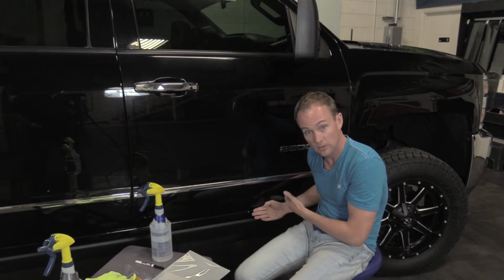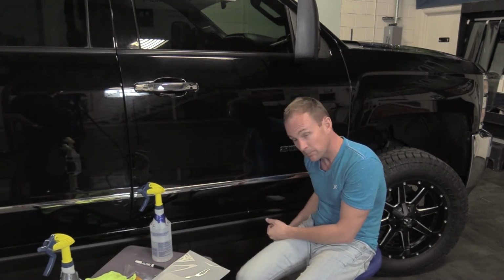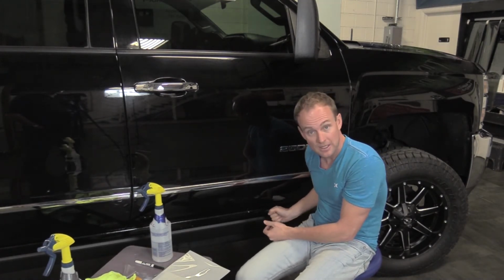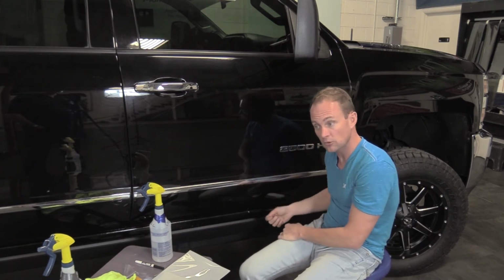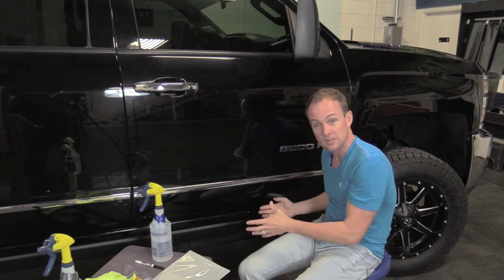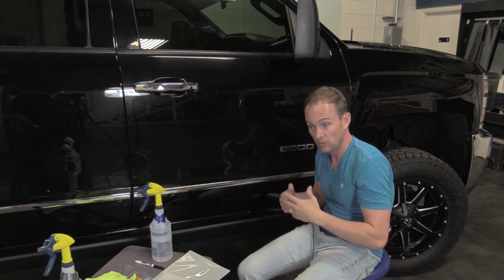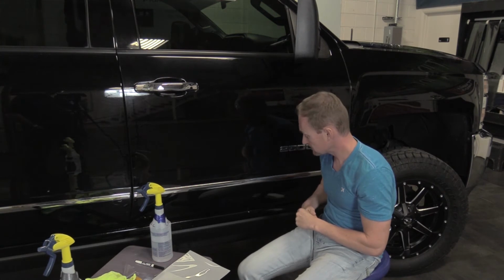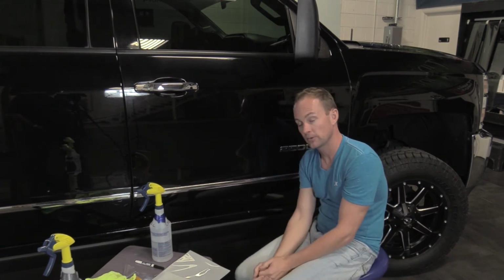On this particular vehicle, it's black. It would look gray at first. It wouldn't cover the chip all the way. You put a little more paint in the chip. You can dry it with a heat gun about a foot away for about 2 or 3 minutes each coat, or let it sit in the sun, or even just in your garage or outside overnight if the weather's decent. And maybe apply a second coat the next day, and then apply your material 2 days down the road.